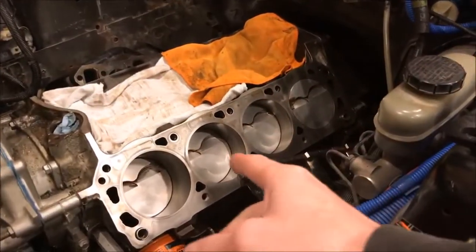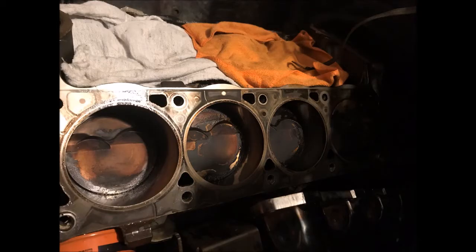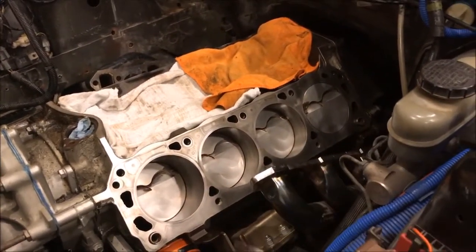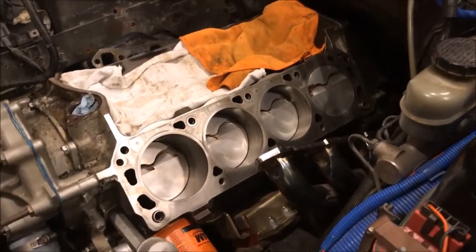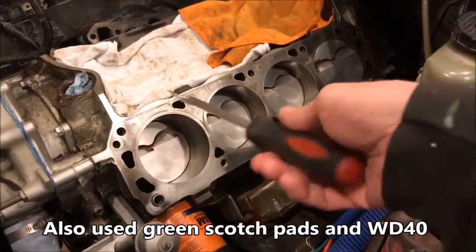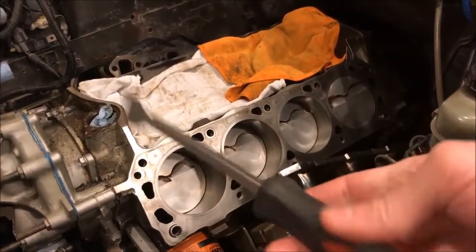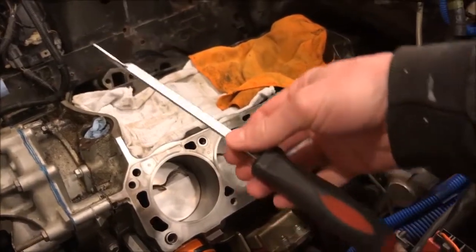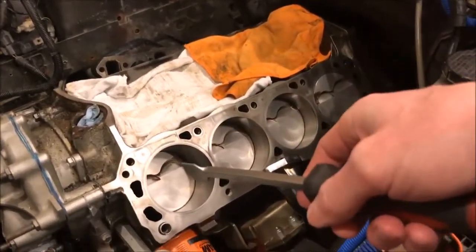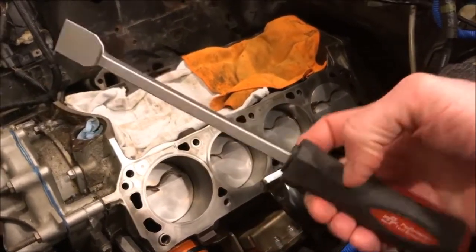Before we start on the heads, let's quickly look at the motor and how I got it to shine up. Here's a before picture — and this is the after. It had about 3,000 miles on it and a little more carbon than I was expecting. I used this gasket scraper to clean the deck and also the top of the pistons. If you've used the flimsy razor-blade style, buy this thing — it is worth its weight in gold. It has a very sharp edge and does wonders getting gaskets off; it's a huge time saver. I'll link it in the description — I got mine at O'Reilly but they're on Amazon as well.